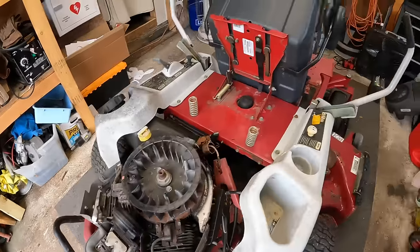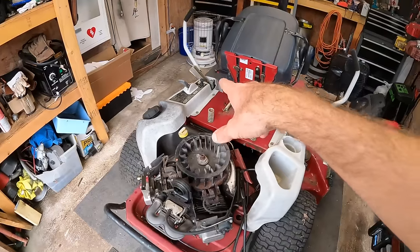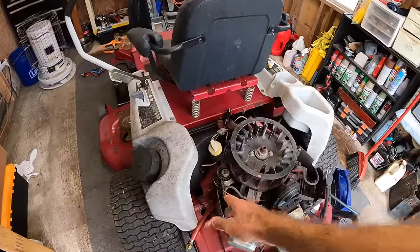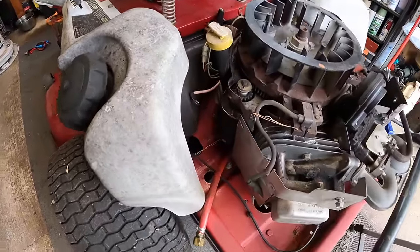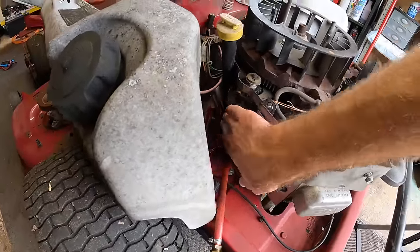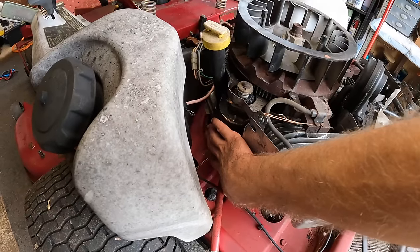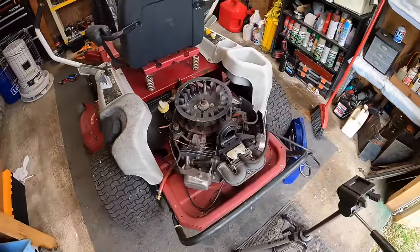Okay, so our anti-backfire solenoid is working. We are getting power, at least to the dash. I'll get the multimeter hooked up to the positive end that should go to the starter. We'll see if we're getting 12 volts to that. And then I guess we'll see about either swapping the starter out or see if we can at least maybe get the lead to touch over here and see if we can get this to spin over.